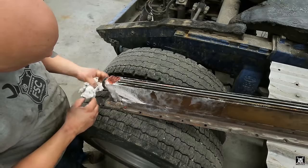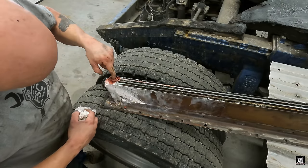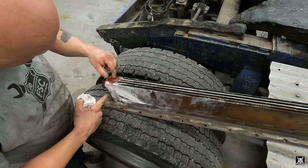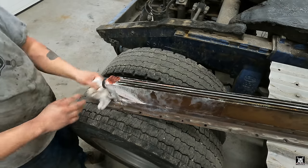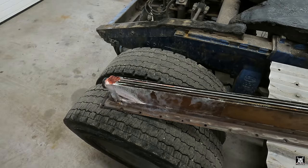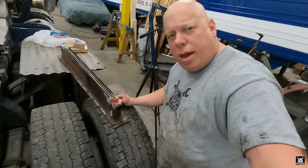I don't think it came out of that gasket. That gasket, the O-ring don't look messed up at all. I think it's bubbling from that seam right where this meets that, or the fingers. She's been dumping water in that hole for a while. Let's go look and see what the inside of the housing looks like. Yeah, that ain't good. That ain't good at all. I don't know, G over at Caterpillar said that thing's like $3,000 or $3,500, $3,400.